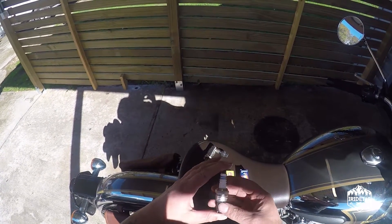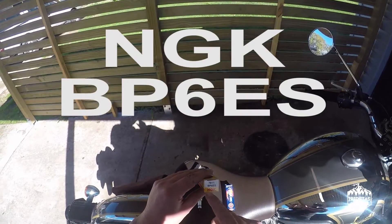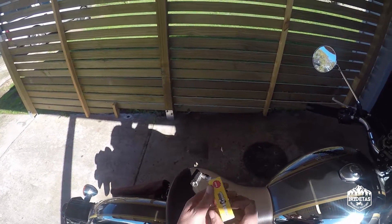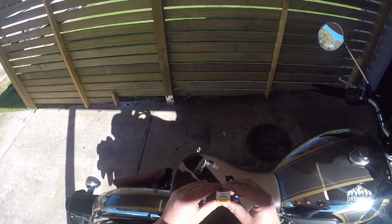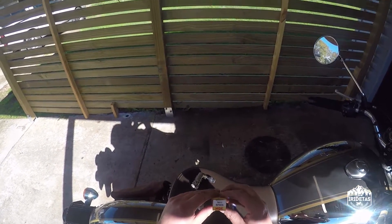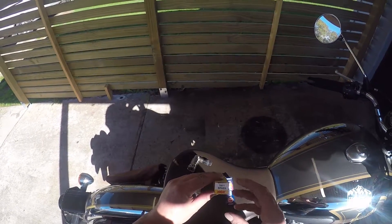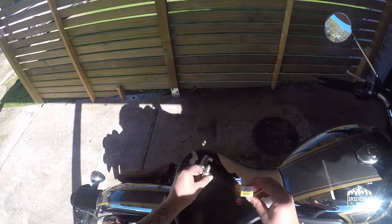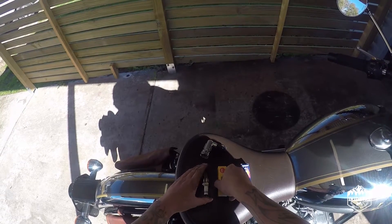I would strongly recommend replacing it with a Japanese-made NGK BP6ES. I found two online on eBay for $14.95 from a lawnmower shop in New South Wales, and they were about $9.80 each at Super Cheap Auto — so it's not an expensive addition. Gap it to 0.7mm; the manual suggests between 0.7 and 0.8 millimetres for this plug, and that's about the correct gapping. It will remove a lot of those problems.